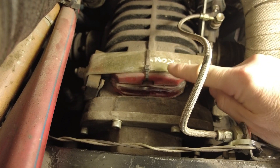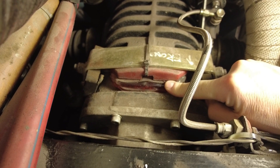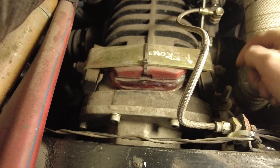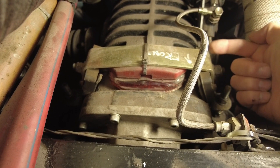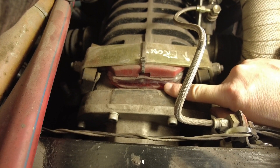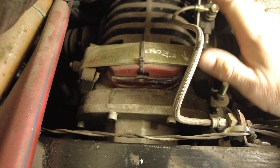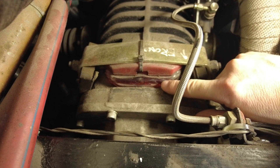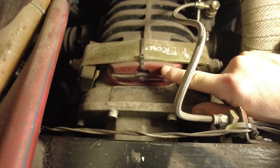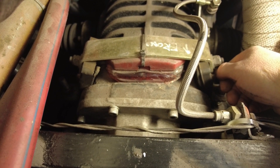For today's task, I'm looking to replace the gearbox bush. The front bush on my gearbox was all temporary - it was done as a last-minute job to stop an issue I had with the gearbox moving. Originally it was designed so the strap went further down the side of the gearbox and these side bushes help stop any sideways movement, with a single thinner one at the front. What I found is it was actually pulling the gearbox down too hard. So it was a last-minute emergency fix before one of the shows. I raised this strap up and put a bit of urethane bush in there as a temporary measure. And to be honest, it's actually worked quite well ever since - that's why it's been there so long.